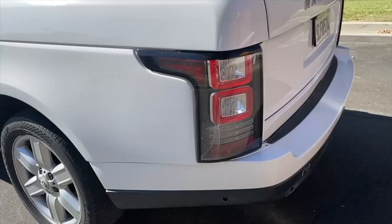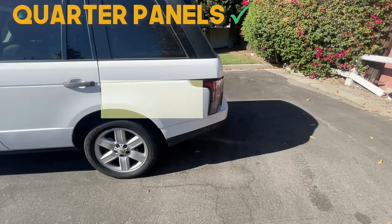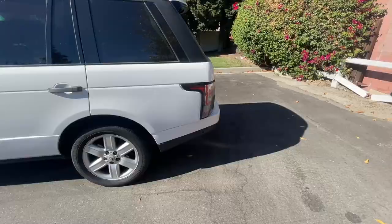The quarter panels are custom parts that are included in the body kit. The fitment is good because the panel can be glued onto the body of the old Range Rover right below the top body line, blending in very well and allowing the newer tail lights to fit. The issue is that a small piece of the vehicle body must be cut out in order for the body kit parts to fit.